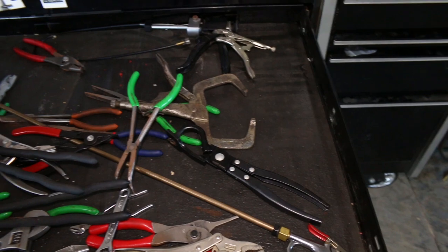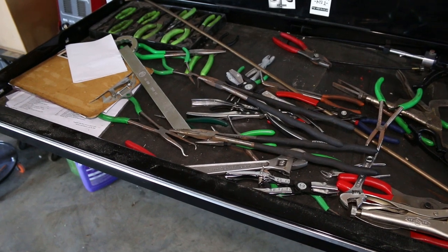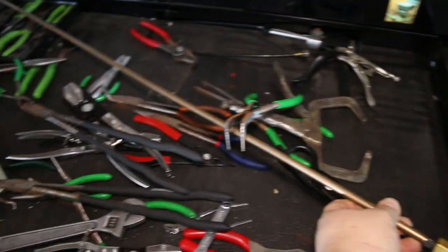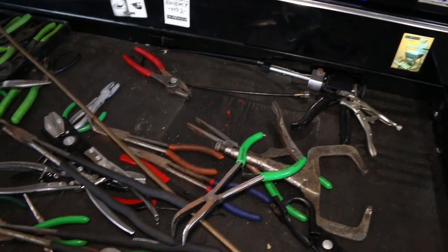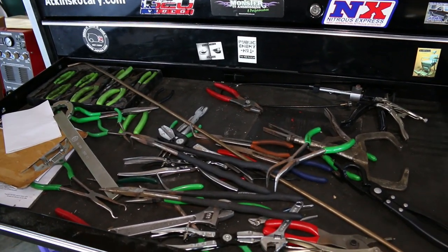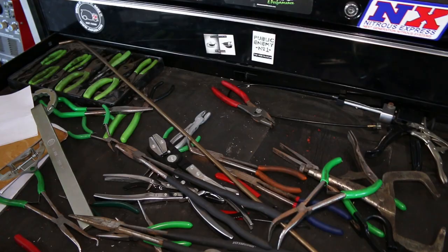The next drawer down is one of those drawers I was just mentioning — I never keep this one organized. In here I keep my pliers and my long blower that I built. If you're ever working on Fords in a dirty environment, I recommend you have one of those. Fords have those top-down spark plug holes that love to get full of dirt, and it's great for blowing them out without having your face right next to it.